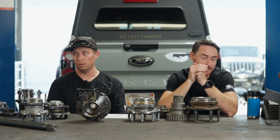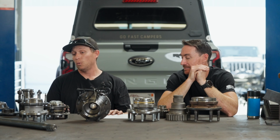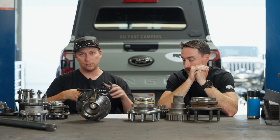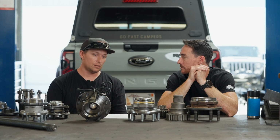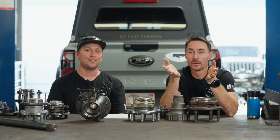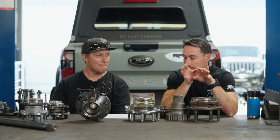Yeah. So the 2 most common ways to preload: you can have a spindle nut, where you set the preload, you back it off, you tighten it up, you're trying to get some kind of fit in there. With unit bearings, the manufacturers have their statistical tolerances where they can smash them together and have a certain percentage pass. This is worth discussing, touching on.